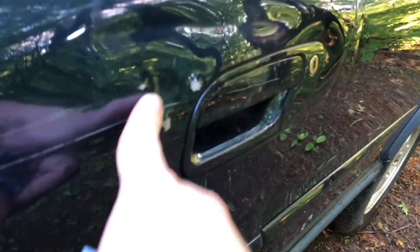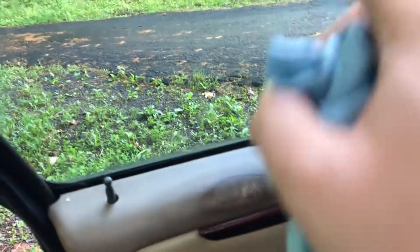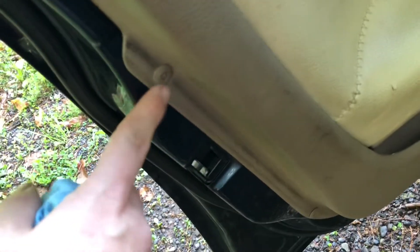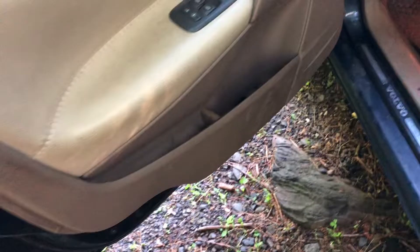It's got this scrape here. You can see it's kind of squashed in there, which has really just bent the window regulator. So this window is permanently up. I'm gonna have to take the panel off — which isn't too bad. You just raise these up and then they separate and come out.